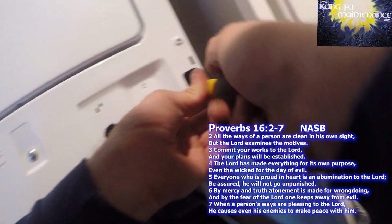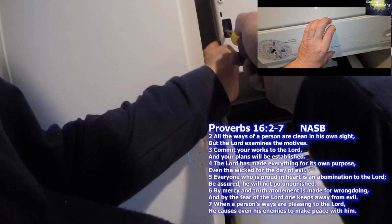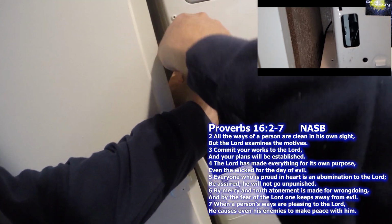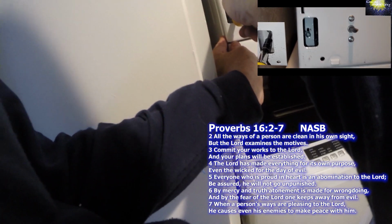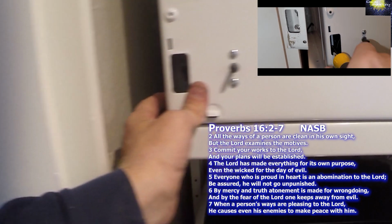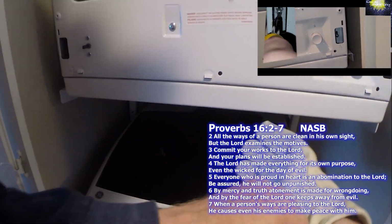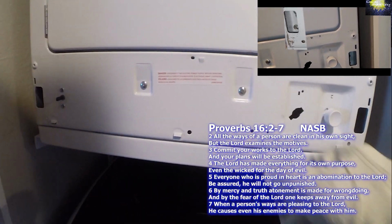And then there's one screw on each side here. You don't want to loosen it too much. You just loosen it a little bit and then lift the screw up. It's on a slide that has a larger opening at the top to allow the captive screw to stay there, and then you can pull the front forward to take the front panel off. It's very sharp. Box of knives. I know, because I've donated blood a few times.